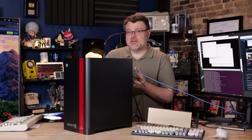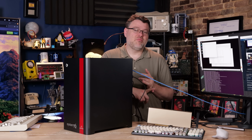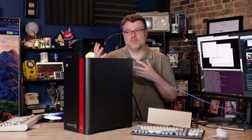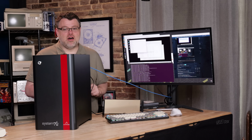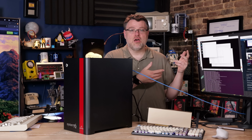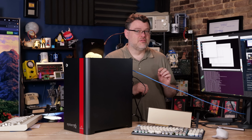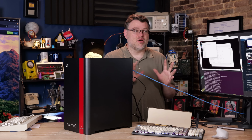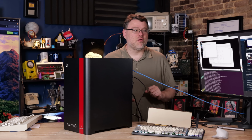However, because NVIDIA and ARM have done a lot of work together, I'm pretty sure that the InfiniBand aspects of it and the SR-IOV aspects of it from that side of things are going to work fine. It's just if you want to go off-label and get creative with other stuff, maybe SR-IOV needs a little bit more polish. But for PCI Express pass-through, running multiple GPUs, passing through a GPU to a Windows host, there's a couple of gotchas there with the resize bar and base address stuff. But this is a good platform for working out those issues if you're a developer on ARM working with it.